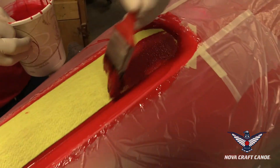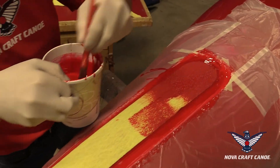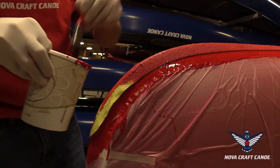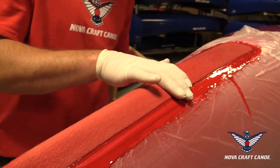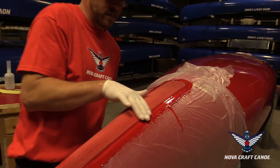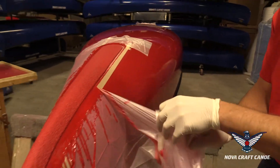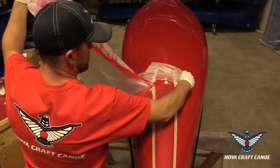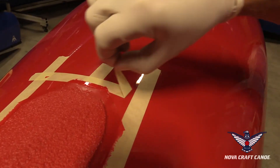Then apply a really thick coat of resin — this Kevlar is pretty thick and it takes quite a bit of resin to thoroughly soak it. You'll probably want to wet it out once and then go back and put more resin on again. With your latex gloves on, smooth it out with your hand to make sure you get all the air bubbles out. Then once the resin starts to set up, peel off your tape, peel the masking off, and pull it away from the skid plate so you don't catch the edge.